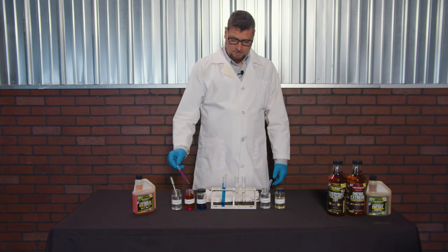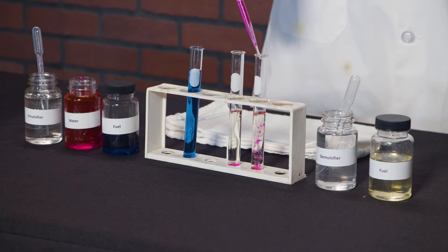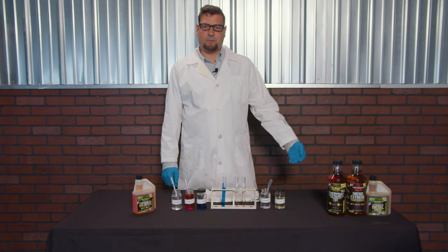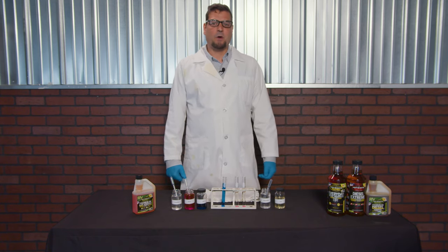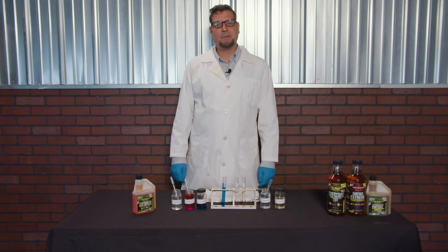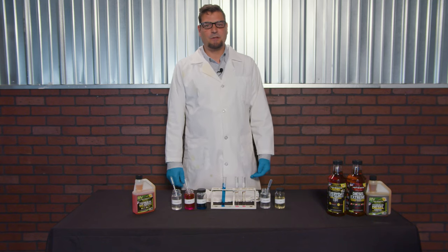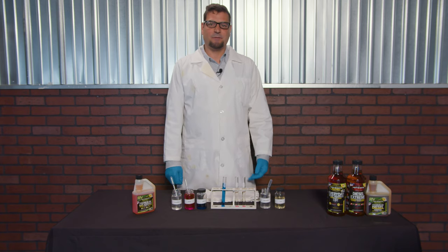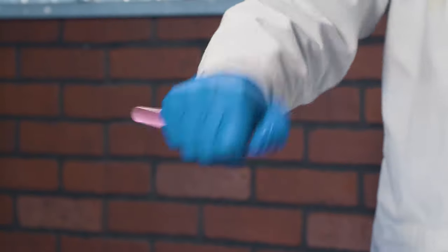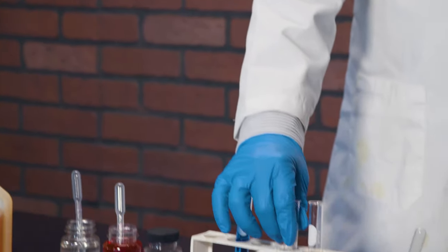Next, we're going to add water to the diesel fuel. There are a few reasons why we use a demulsifier for diesel fuel. The first is it is easily separated by the water-fuel separator so you don't run the water through your system. Water reduces lubricity and causes more wear and tear on your parts and fuel system. Another common problem is steam from the high pressure and high temperatures — the fuel system will actually blow off the injector tips on some vehicles. I'm going to shake it up to show that even though it does separate, the water is still suspended in the fuel because it's cloudy.